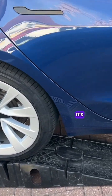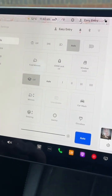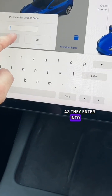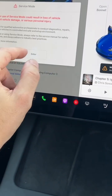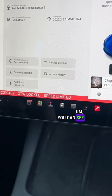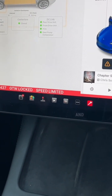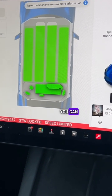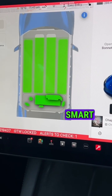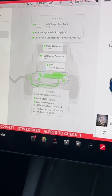Let me show you what I do on electric cars — Tesla specifically. On Teslas, normally everything is limited with the diagnostics on a few models as they're going into aftermarket repairs. But it does have a self-diagnostic mode and some features where you can check the service mode. You can see service alerts, the high voltage battery, and you can actually see the data and the state of health. You can ask the seller before you purchase it to do the state of health test — they don't really need any smart diagnostics to read things; you can see all the issues and everything will flag up.